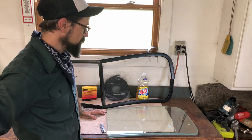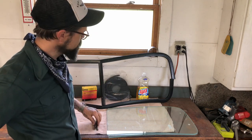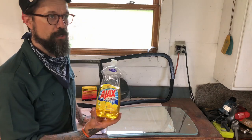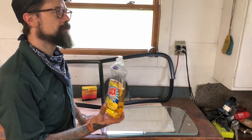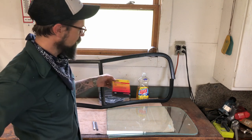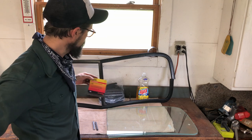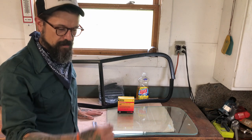First make sure you have all your materials on hand. You've got your glass, you've got your bars that go on the side inside the frame of the windshield. You've got your weather stripping which aligns the exterior. We've got the dish soap, which is going to help us put that in there. And we have this 3M splicing tape. We're using this in lieu of glass setting tape, which you would traditionally use, because it's slightly thinner, and if we need more thickness we can just stick it to itself.